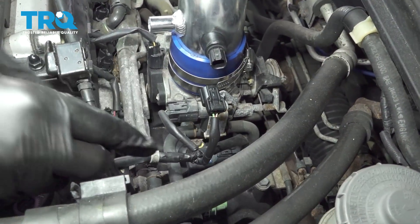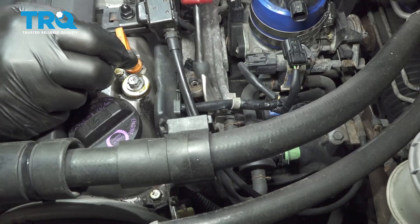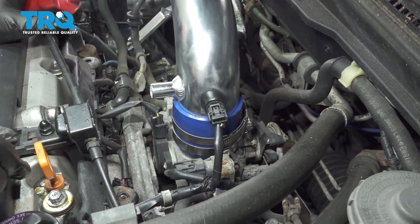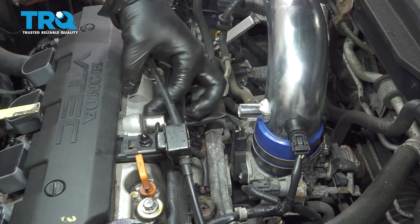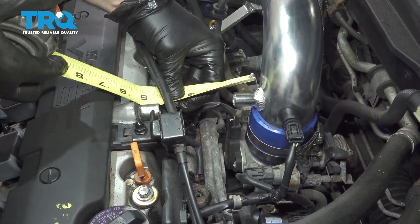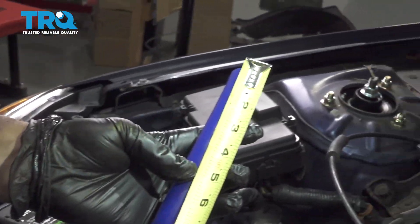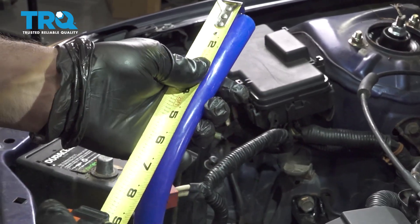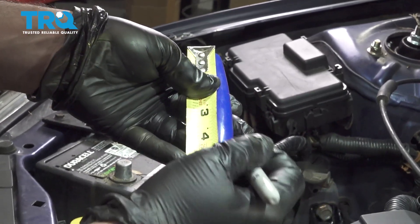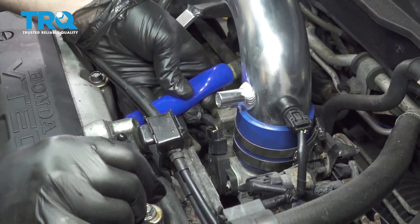We're going to go ahead and connect this connector, but it's a little short. There's a little retainer tab right here — we're going to use our trim tool remover and pop this clip right off. It's going to allow the flexibility of this harness to come on up. Line this up and plug it in. Now I want to go ahead and measure the hose to connect from the valve cover to the intake. I'm going to use our tape measure — we're looking ballpark about four and three quarter inches. Going to measure out four and three quarter inches on this hose right here, mark it up with our Sharpie, then go ahead and cut that and install our crossover tube.